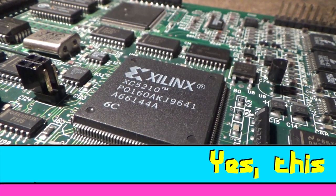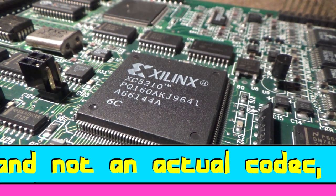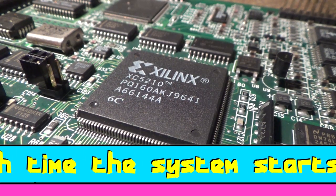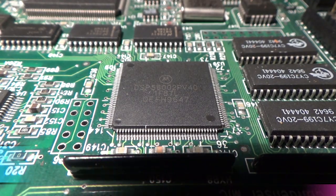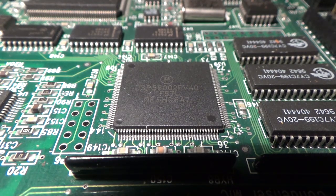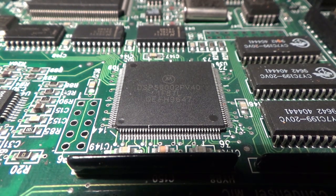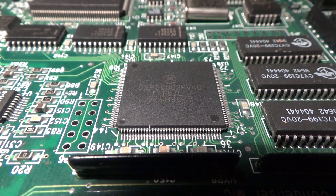The Turtle Beach card appears only as an MPU 401 to DOS applications, although its joystick port can be enabled for them with the use of a driver, but it takes up a bit of conventional memory, so I wouldn't bother. The Vibra 16 was simply there for compatibility and the extra inputs, as well as echoing MIDI through the machine, a bit like the Sound Canvas does now. Naturally, having things set up this way sacrificed having a Yamaha synth and meant the MU90R would have to be permanently tied to this system.